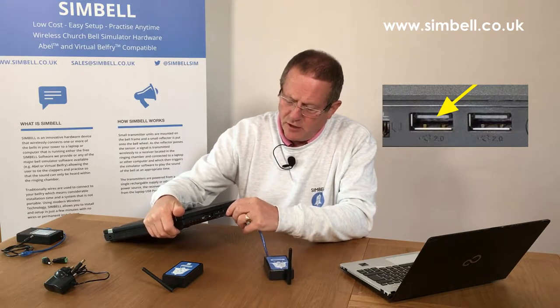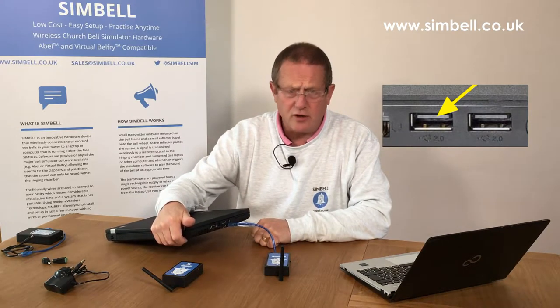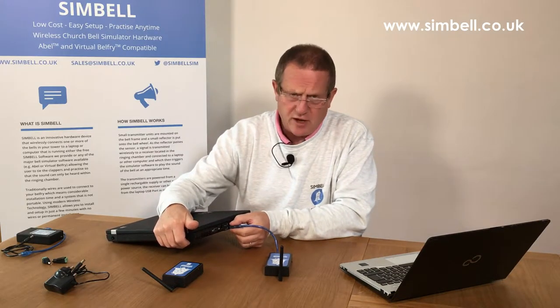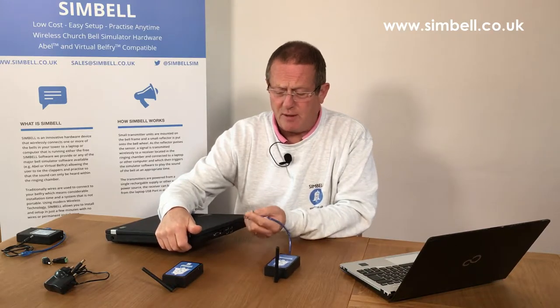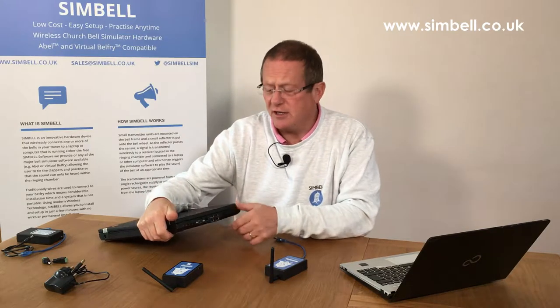When you plug it in, the two interlock and provide a good connection. If the cable is damaged, or that piece of plastic is damaged, or the piece of plastic in the connector is damaged, then you must not use that port. There is a chance that the five volts present will short against one of the other pins, and that could in fact short out the whole power supply to your laptop.